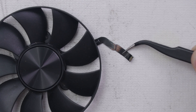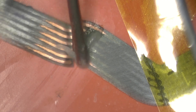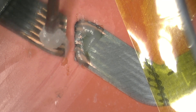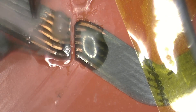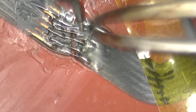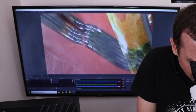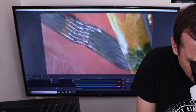This is definitely going to be a challenging repair. First, we have to match up each of these circuit traces on each end of the ribbon cable. Then we need to repair the circuit trace — I'll be using a little tiny wire to solder onto each of these traces. Then we have to fit it through the little ribbon cable housing on the graphics card itself and see if we can get it to plug in without damaging any of these traces. I'm going to get some flux on each of these lines, then come through with a little bit of solder and tin them up. Then I'll come through with a tiny piece of wire and solder each end to each end of the cable. After that, I'll come through with some solder mask and a UV light, which will help to strengthen each of the wires and joints. This definitely isn't the most beautiful soldering job, but it'll definitely do the trick. I may need to go back and clean up — there's kind of a big blob right here. We'll have to see how close the tolerances are where this cable needs to go through, but I think we have pretty good connections and this is going to last a long time.